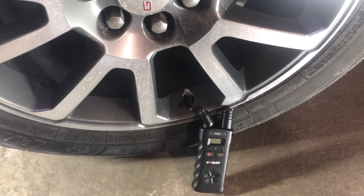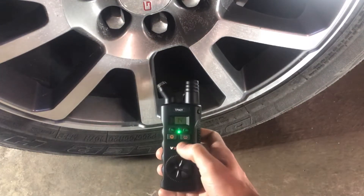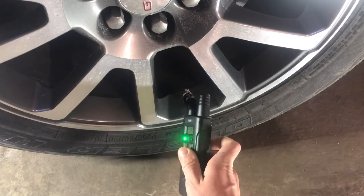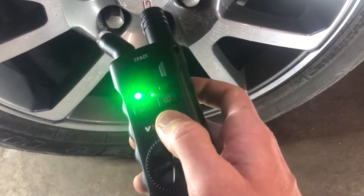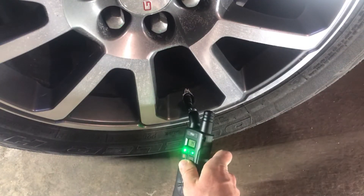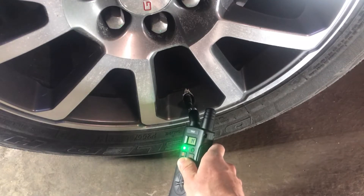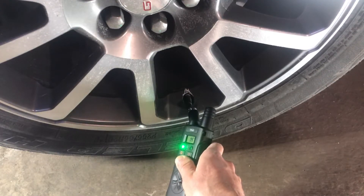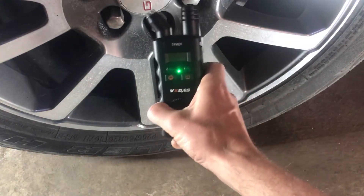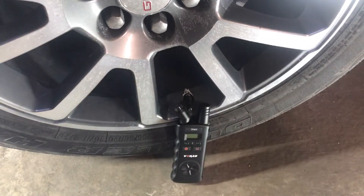What you're going to do is just press and release this right button. We'll put it in here, then press and release this button — which is the tire pressure button, the one we think of when we have low tire pressure. So you'll press and release that button and just wait for the horn to sound. Once the horn buzzes, the information's read, then go ahead and go to the next one. Just go around and do those at each tire, following the same process and following however your car responds or confirms once you've got it at the right pressure.